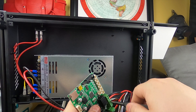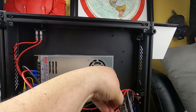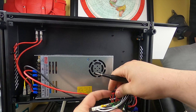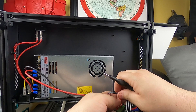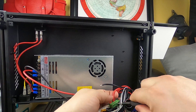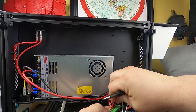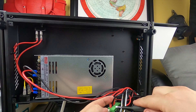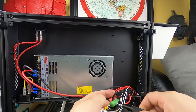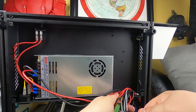We can go ahead and unscrew both of these all the way. It's a big wire there — it must be the bed. Just push it in there, make sure you got it nice and snug, then snug down the screw. Do the same thing for the black wire. I'm going to show you there's a little square down in there — that's where I fixed a printer for somebody one time where they tried to do the swap themselves and it didn't work. That was the problem — I think more people make that mistake than people know.